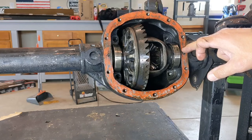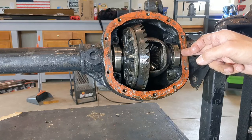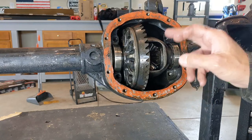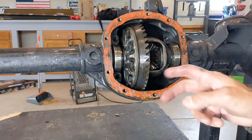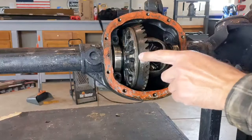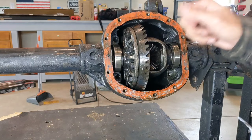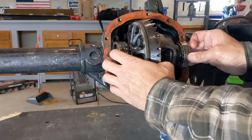Because this is an open carrier, the bearings are pressed on with the shims underneath, so I'd have to pull the bearings off to find the shims. A very good rule of thumb is to see what the shim stack is side to side, write it down, and use that as your starting point when installing your ARB. One note of caution: when you put the carrier back in, check your backlash as you're doing it. If you have no backlash and you keep trying to beat the carrier in, you're going to have problems. So as you're tapping it in, make sure you have backlash.